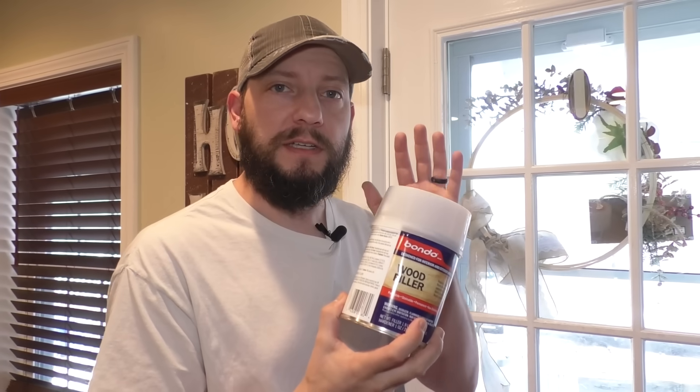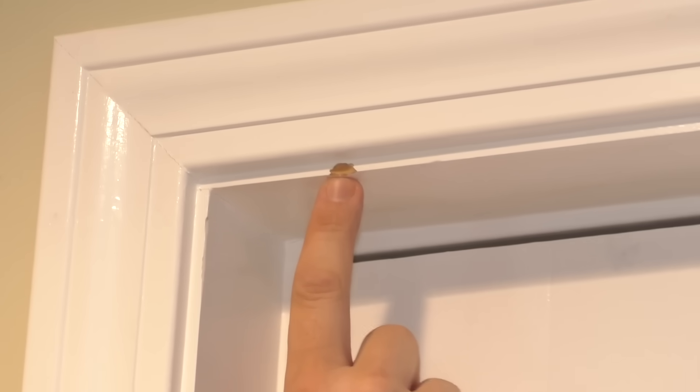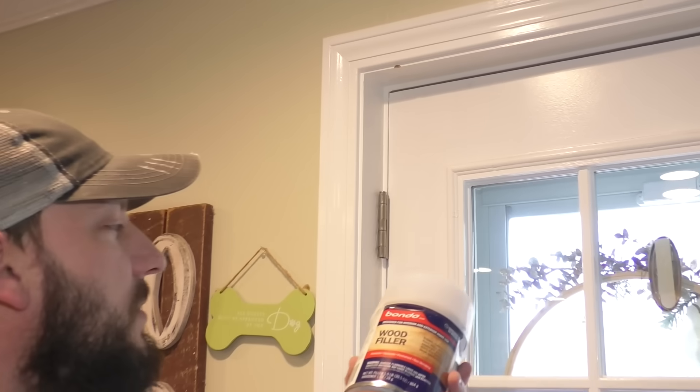This little thing right here is incredibly easy to fix if you use the right materials. What I'm going to use is Bondo for wood. It's a whole big can for this little tiny thing, but I have a ton of other stuff in my house I can use it for. You could probably get something smaller. You can use whatever you want — I would just suggest not to use spackle or any kind of regular wood filler because it's not strong enough for something like this. Because this is on the corner, you're going to want something that's going to stand the test of time. If you just use regular spackling, even if you just brush it like this, it's going to fall apart. So that's why I'm going to use this stuff. I love this stuff, and I'm not sponsored by Bondo, just so you know.